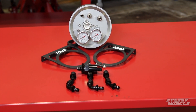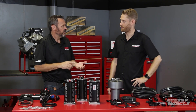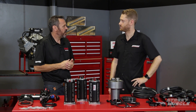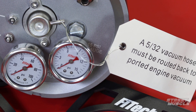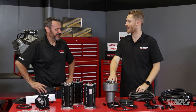The plumbing needed comes in the kit — high-pressure fittings, filter, and hose — but you do have to run a vent line back to your tank. A lot of tanks already have a vent line provision, and if not you can put a vent line into your filler neck — not terribly hard to do. But it has to be done; if you don't want to do it, this isn't the option for you. Noise-wise compared to the inline pump, these things are substantially quieter.